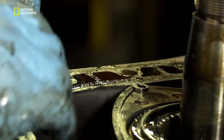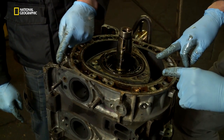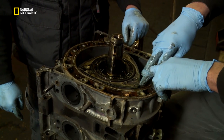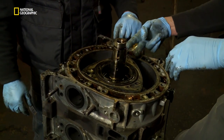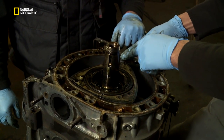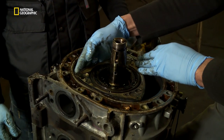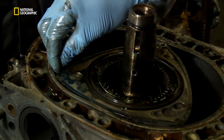From this side it's rotating around, pushing it around, and then pushing it back through the exhaust port. This would be the point just after maximum induction has happened. As this goes around, it starts squeezing, and the spark plugs are coming in here, so it gets squeezed to a maximum — at that point the spark plug ignites, that's your compressed boom. At this point here, the rotor pushes it through and it's just about to open the exhaust port, and then this tip will come around and squeeze all that exhaust gas out of the exhaust port, and then it starts all over again — repeating and repeating.